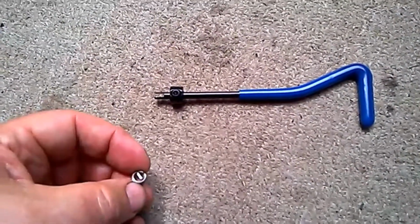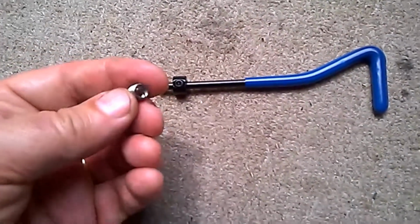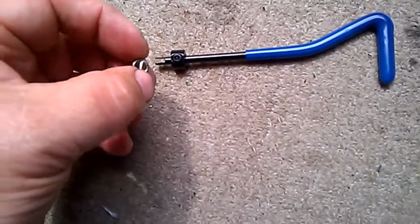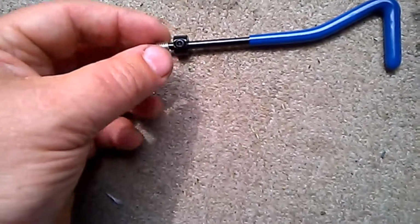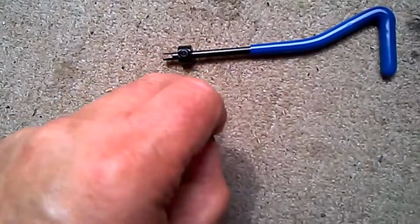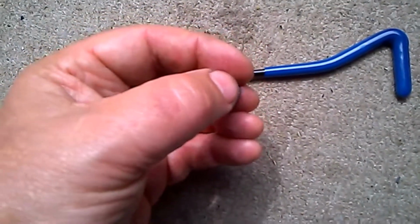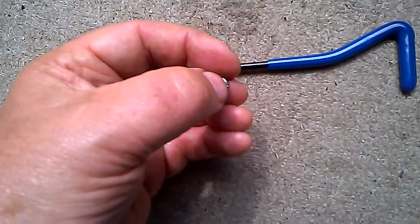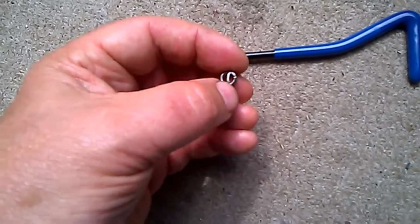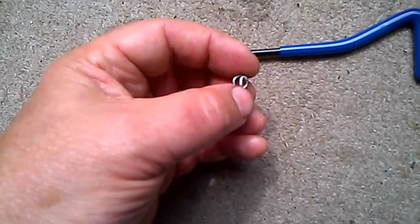This is the helicoil insertion tool. What you do is you take the helicoil here, got a little tab on it there that sits in that groove, so you slide it on that way until it rests in there, and then you use this to insert it in, and this little tab has got a tiny little cut in it, and you hit it with a little tool that's supplied. It's just a rod, and break the tab off once you've inserted it.